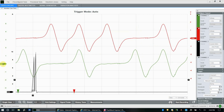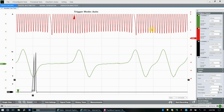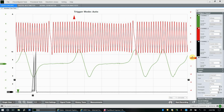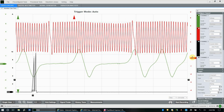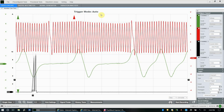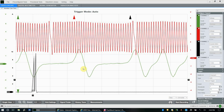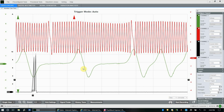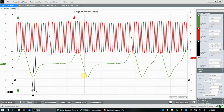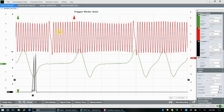Now, it doesn't help you if you're in the wrong wire, so I'll show you what happens if you go in the wrong wire. As you can see, I just moved that channel 2 over, and now we have a completely different wire. So you do need to be aware of what you are probing and where you are probing into. Make sure your pin numbers match your wire colors, and be sure to remember what you're looking for. We're looking for a VRS sensor. If you go into workshop manual description and operation, it tells you it's got a 3-in-1 trigger on it. So we should be seeing 3 peaks and 1 and then 3 peaks, right? Which is what is happening here.